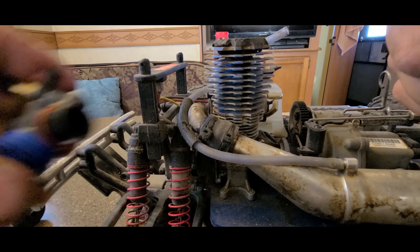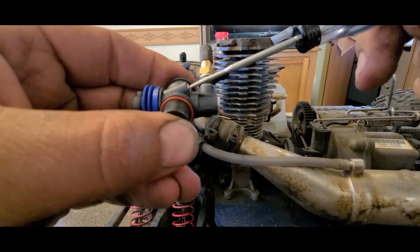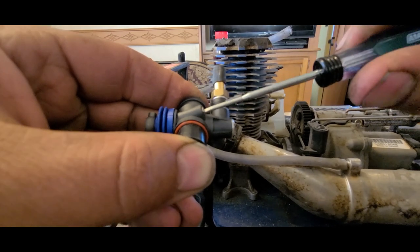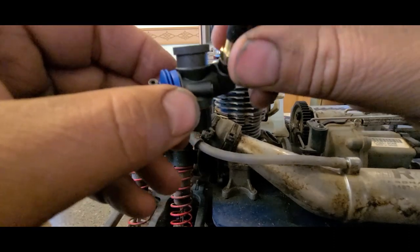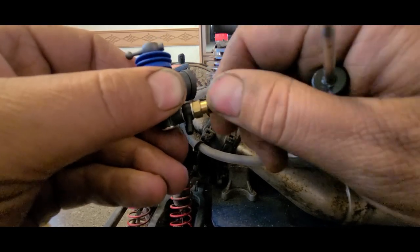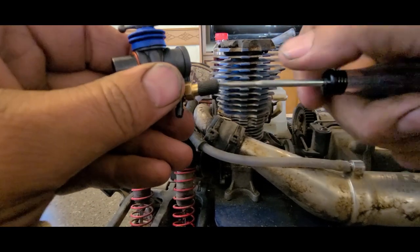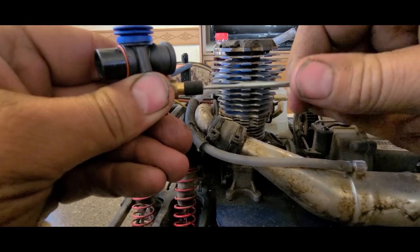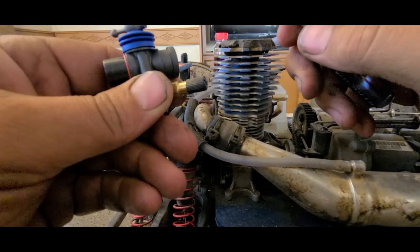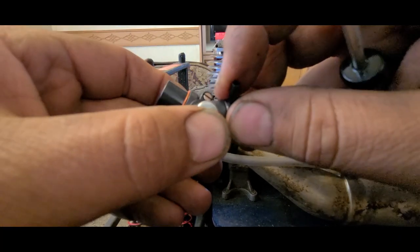So I'm thinking with the new O-ring on this one and the adjustability right here. Oh yeah, she's working. We will have a lot better running truck. Probably need to set this to factory, which I believe is 2.5 revolutions from all the way down. So, 1, 2.5. Well, that should be factory starting out. I'm sure I'll have to fatten it up quite a bit.